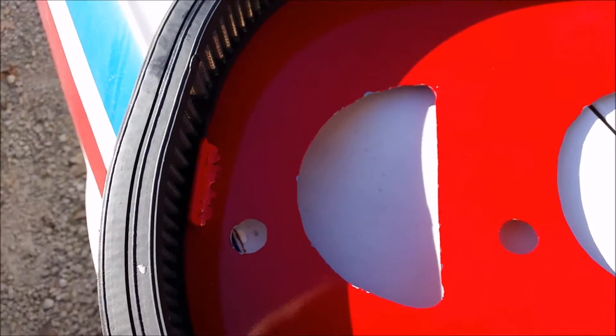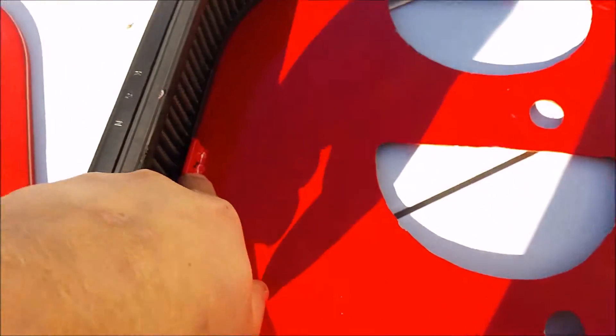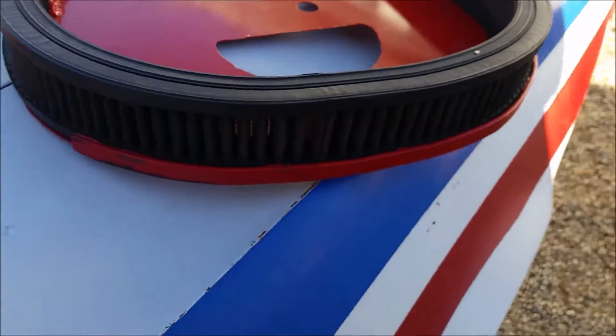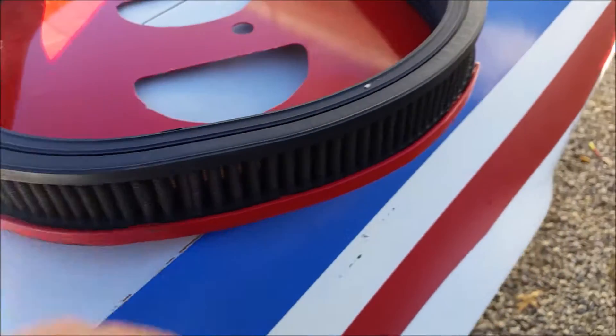I made my own base. Let me just stand right here - this is a piece of sheet metal that I made a cardboard template out of, and then I just welded some tabs to hold the air cleaner. I have another version I made where this goes all the way around - I just haven't finished it yet - and that holds it on the outside.